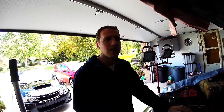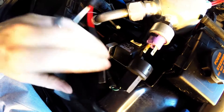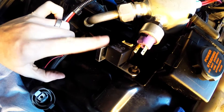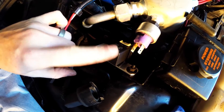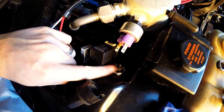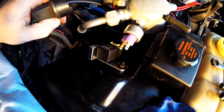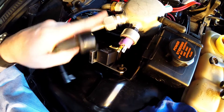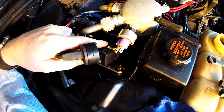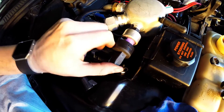This is pretty simple, but I'll just give you the highlights on how to install this because it's a really neat little setup. I'm holding these wires up out of the way the best I can. This is the unit from Innovative — that metal bracket there. It's all included, everything's loomed. You bolt it down right here to this power steering bracket. I went through and cleaned all this; they do say in the instructions this connection on your AC receiver dryer could interfere, but mine seemed alright.